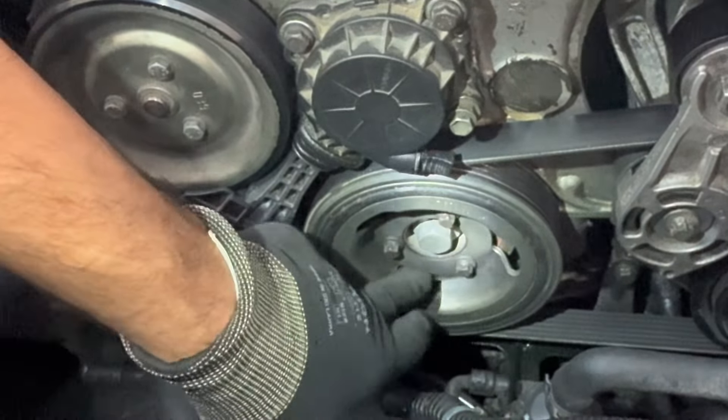The main problem is that whenever the PCV diaphragm is faulty, this happens. I'm going to clean in here and change the PCV to see if the problem stops. The PCV diaphragm is available from the Chinese market — AliExpress — so I bought it from there. There was no membrane brake sound coming from the car, which is why I didn't change it until now.